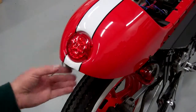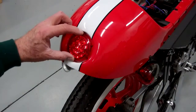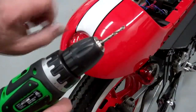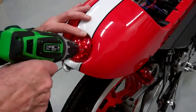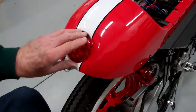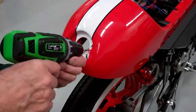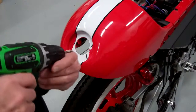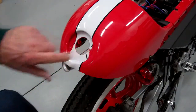Go ahead and insert the light in the hole just like that. Now we want the holes to go side to side, not up and down. So we're going to mount them like this, side to side — hold that as straight as you can. With the drill bit we gave you in the kit, go ahead and line that up straight across, then very carefully drill through that hole and into the aluminum. What I do is drill in just a little ways to make a mark, then pull this out. Lay your hand on there so as you drill through and it breaks through, it won't jab through and screw up your paint. Go a little slower and steady as you drill. That way it won't wobble around. Drill the one hole and then we'll show you how to drill the next one.